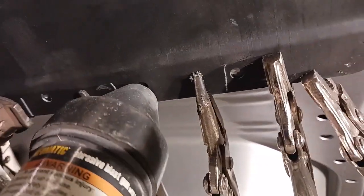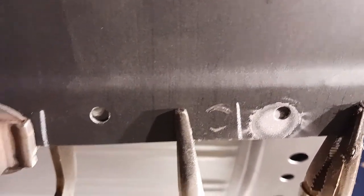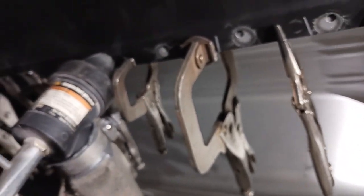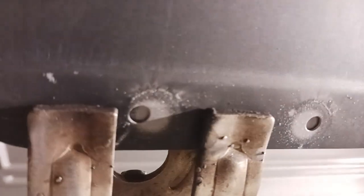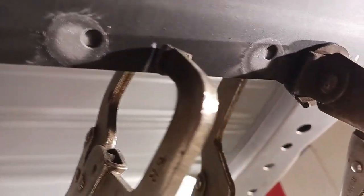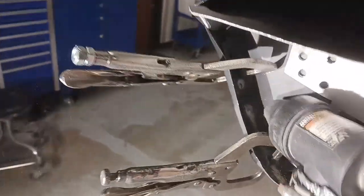You know what we do here — mini blaster. This is just regular sand I've got in here. We're going to be removing some material from around the quarter panel and the place where we're going to be welding. A lot of guys grind the backsides, but we want the EDP coat or weld-through primer — something always has to be in between two pieces of metal like a sandwich. Otherwise, it's a place where rust is going to start. Doing it this way minimizes the amount of coating that we have to remove.